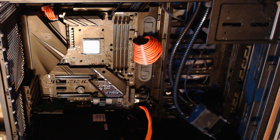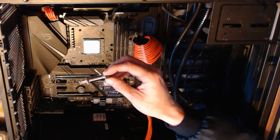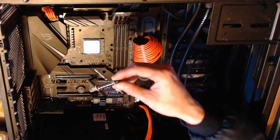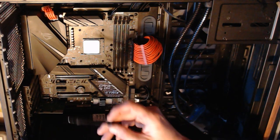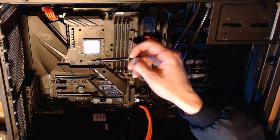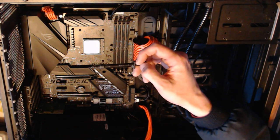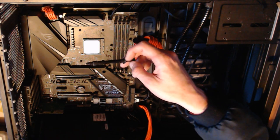Also here, we've got some Arctic Silver AS5, which is 99.9% concentrated silver inside this. And I'm leaning towards using this because silver does conduct heat a lot better. Or one of the big guns in the thermal paste world is Thermal Grizzly, and this is a liquid metal. And this does a lot better job than standard thermal paste. You're going to get temperatures 5 to 10 degrees lower depending on the cooling solution that you're using, but it can do damage to certain parts.